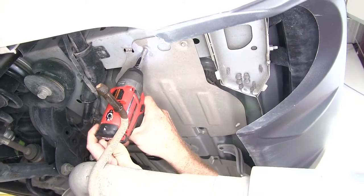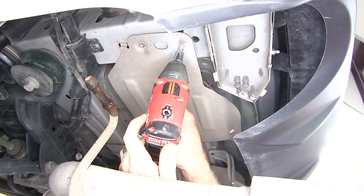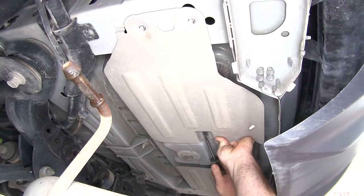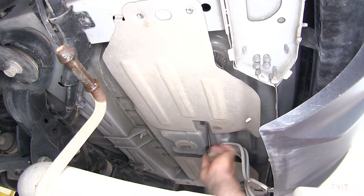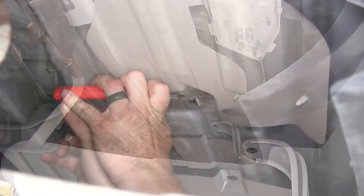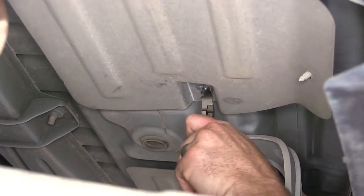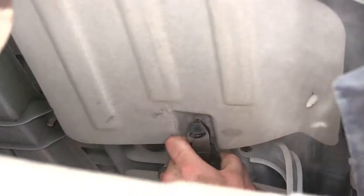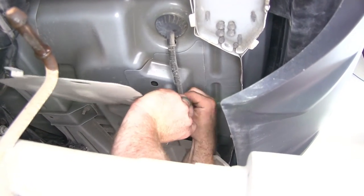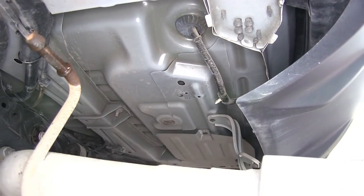Now we can take an 8mm and remove the three small bolts holding in this heat shield. You can take a flathead screwdriver, just get it up underneath the edge of that little plug there, and just pry it downward. And if it's giving you a little bit of trouble, you can grab a pair of side cutters. Just kind of slide it up on either side there and pry downward. We've also got a little push pin attached from the back side that we can just reach up and pull out in order to get our heat shield out.